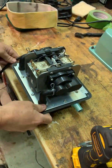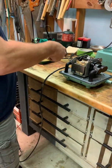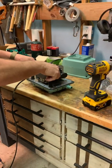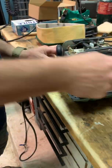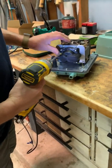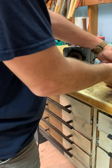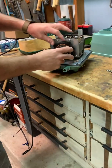Remove this insulating sound sock. This is what we're after — these two right here. Get your rebuild kit that you've ordered from Amazon or wherever you got one. Disconnect the tubes, twist them out of the way. There are four screws — remove those. Now you may be tempted to keep parts of this; don't. Everything here is disposable but the screws — all this goes in the trash. And here's the part that fails: this diaphragm.